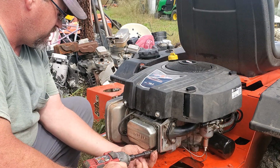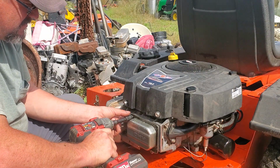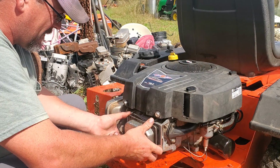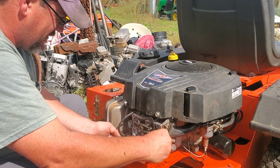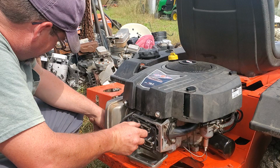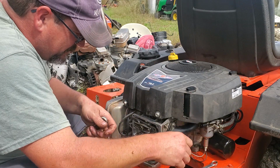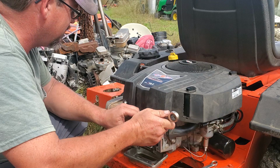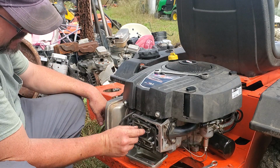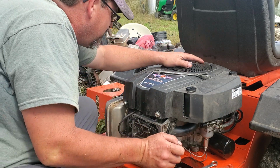See what it is. Four bolts come out of the valve cover. I like to pull it and go straight underneath because a little bit of oil is going to come out. Alright, so this is either going to be a 5/8 or a 9/16. Nope, 9/16 is no go. 5/8-ish. So there's a star bit inside there, and that sets the depth of this pivot ball here.